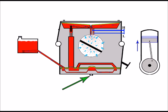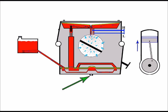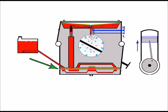And it's this screw here that keeps that cap up tight in place and holds the diaphragm in place. And when this screw's nice and tight, obviously keeping the cap onto the carburetor nice and tight, everything's working as it should. We've got the fuel coming in from the fuel tank, entering the carburetor, and it's being used inside the carburetor there, going into the Venturi as air and fuel mixture, and all's hunky-dory, all's well. Generally, it's down to one screw to hold this cap on and hold it on tight enough to get the correct function of the carburetor.